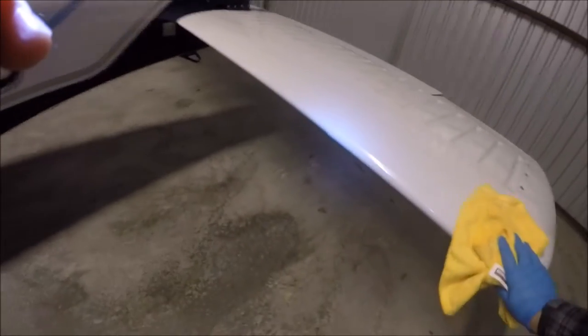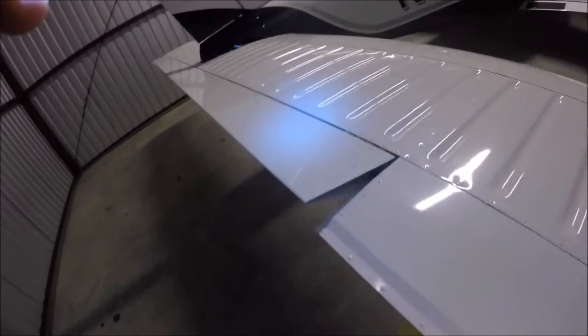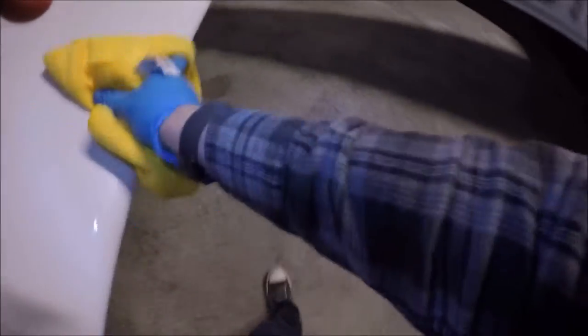Going through here, checking the antennas and cleaning those off. With the chamois, you're not really building static so you don't have anything to worry about. Going down here, making sure my letters and numbers are looking good. I have my certification placard. Down here, making sure the leading edge of the elevator's good, everything's good, hinges good. Flap looks good. Going down here for a secondary check — moving up and down, everything looks fine. Cleaning the edge. I look down to make sure the tie-down's good and all my screws from my ELT are good. Everything looks good from this side.